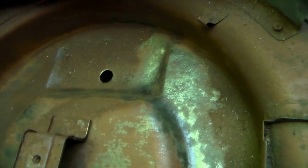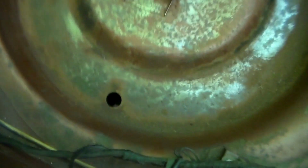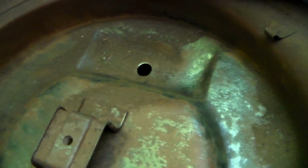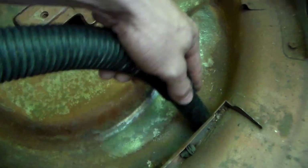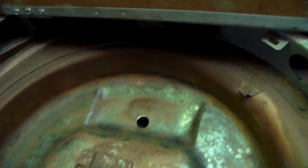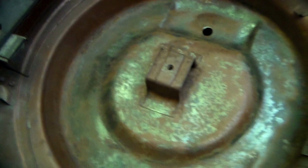Alright, what do we got? So we got some divots around here. Yeah, this car is really thin to begin with, so not too concerned about it. I don't know, this spot on this car normally rusts out, but you can see the drain holes are still in good shape, so must be good. Just holding moisture. So I gotta do more here, here, here, here, here, here. So basically this whole thing has to be gone over again.